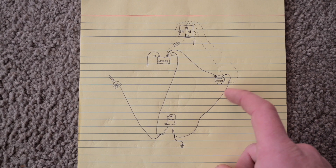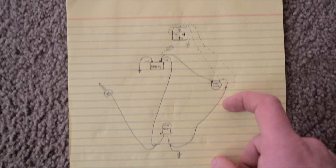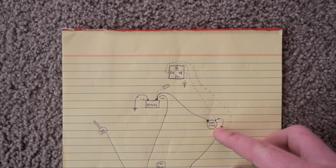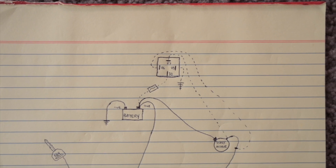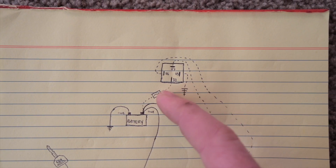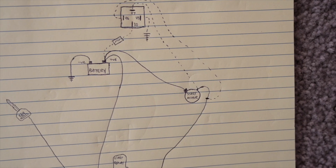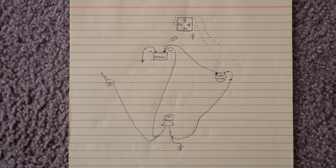This is the wire that is losing its current — the red and black wire with that plug on it. I get a wire tap from this wire: even though it's only 8.5 volts, it's enough to flick the relay. Tap off this wire and run it to pin 86. Pin 85 is your earth. Pin 30 gets the fused constant power source — it doesn't have to come straight from the battery, just any constant power source. Pin 87 is your output, which then goes back to the small terminal on the starter motor. Keep all the standard wiring on there and just run it all in parallel.